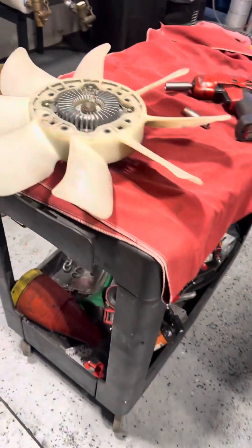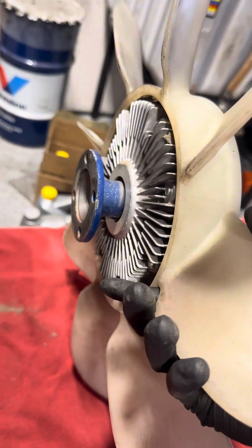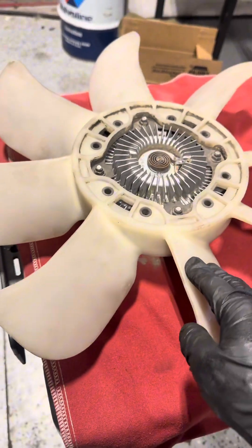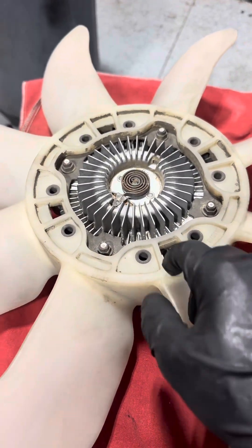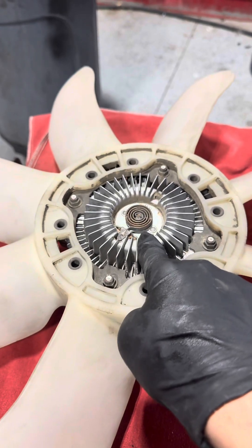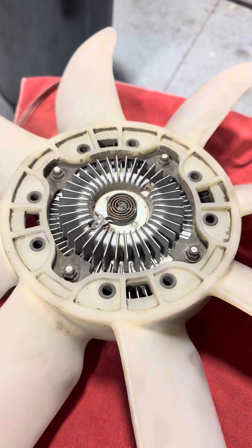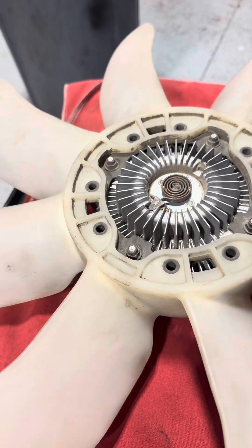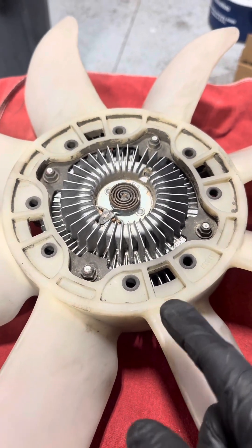I got the fan clutch off early while the coolant's draining because I'm going to drain the oil out of this. This is a newer fan clutch that was replaced with the motor. I'm going to take this fan off because the fan gets replaced with a smaller ring fan, and I'm going to change out the oil and open the thermostat a little sooner. I'll put this into a pot of hot water at around 97 degrees, then clock it until the thermostat is open, lock it down, add the oil, and throw it all back together.